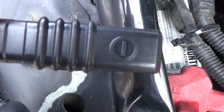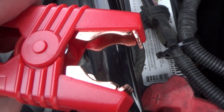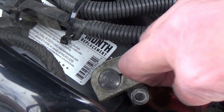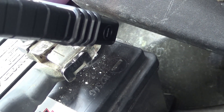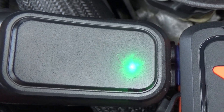The black cable has a minus on it — it's the negative cable, and it goes to the negative terminal on your battery. So open up the clamps, remove any covers you have to, get those out of the way, and attach the cable. I've got the positive cable attached. Now I have attached the black cable to the negative terminal on the battery, and the light is a steady green — that means you're ready to go ahead and jump start the vehicle.